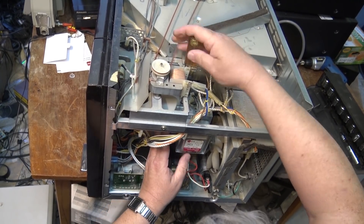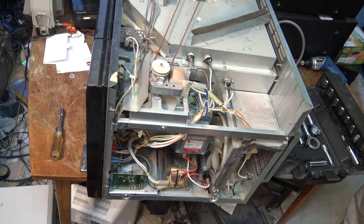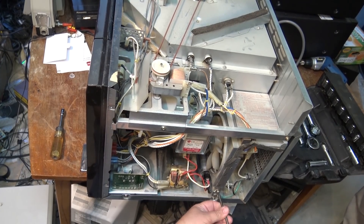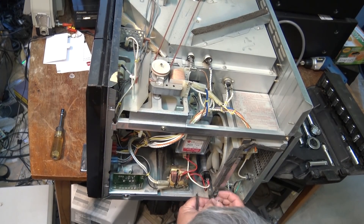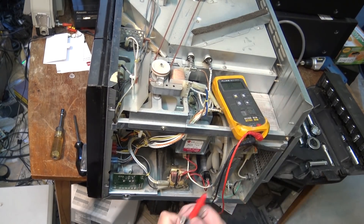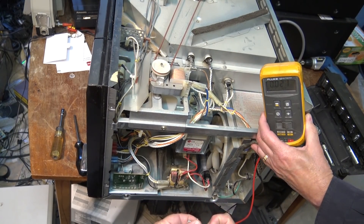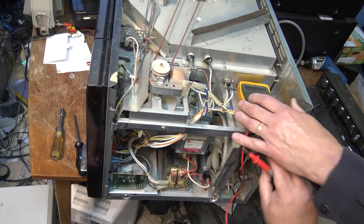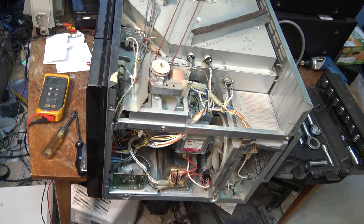I'm just going to pick that diode out and check it out. I'm sure that the diode is probably shot. Well, that wasn't even clipped into anything — what the heck? That was just shoved in there. Let's see what it is. Yeah, that diode shorted. That diode is shot. It's a good thing you got a new one. What would make it go? A magnetron short maybe? I don't know.